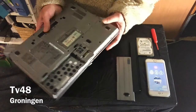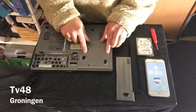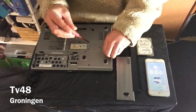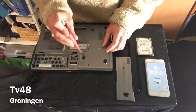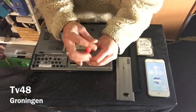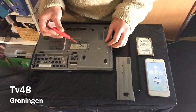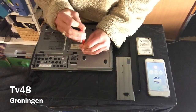So that's what we're gonna use, and there you can see three screws. We're gonna loosen them up — these screws are holding the bay and the drive in the laptop, because we will slide it out. In fact, this is a replacement that can be done under 10 minutes, so it's no big deal.